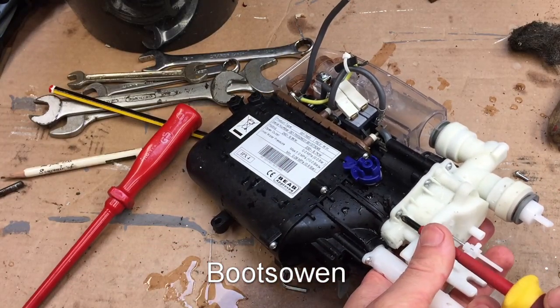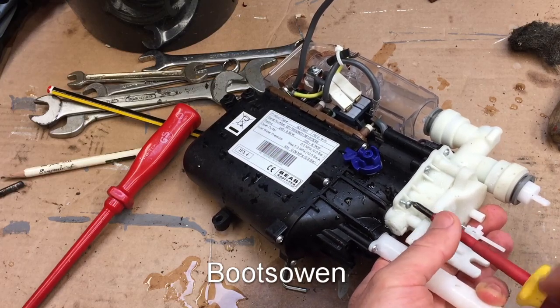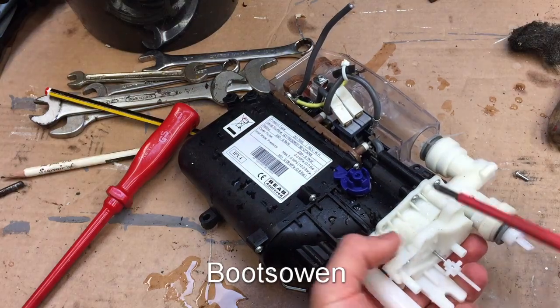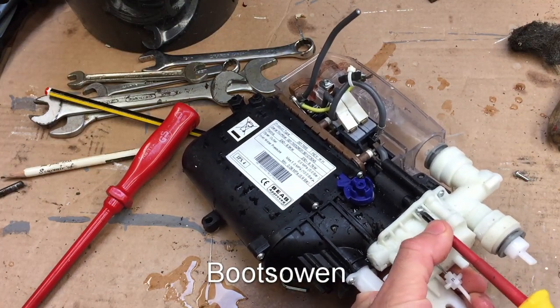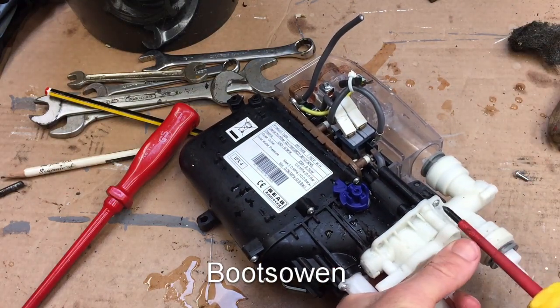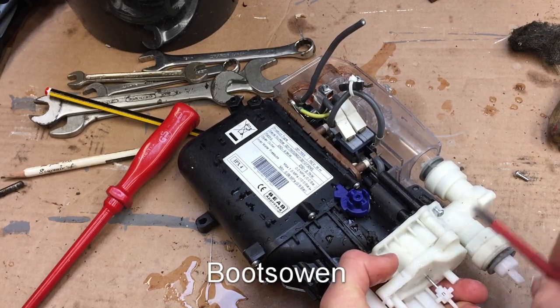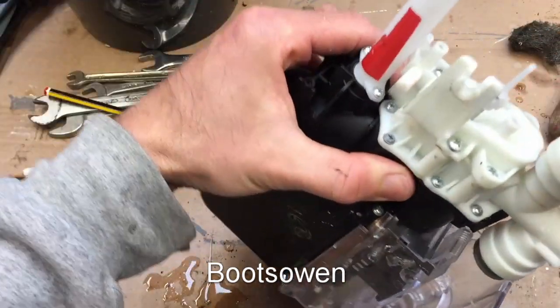Solid-state switches — and those had a water-cooled effect. The point I'm making is it was all a single unit, all screwed together, rather than the Triton Myra style of having loads of individual components that you can service in situ. With this one, you couldn't do this with the shower fitted to the wall — you would have to take it off.